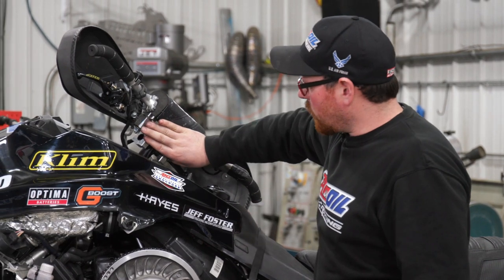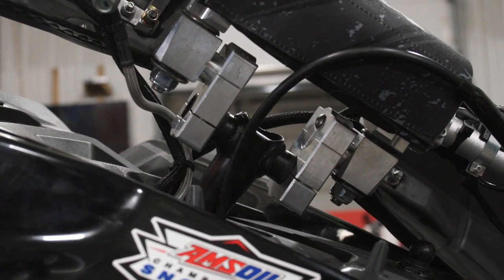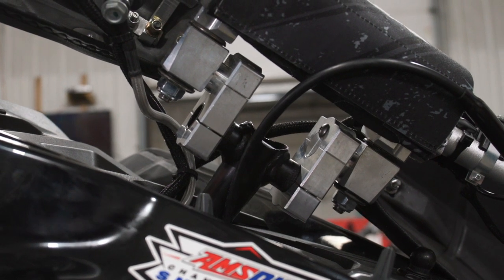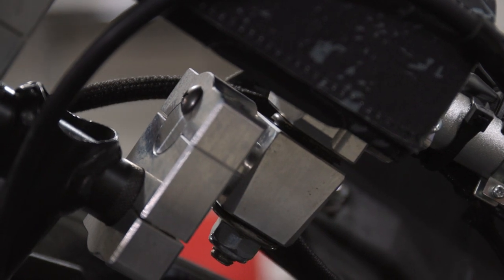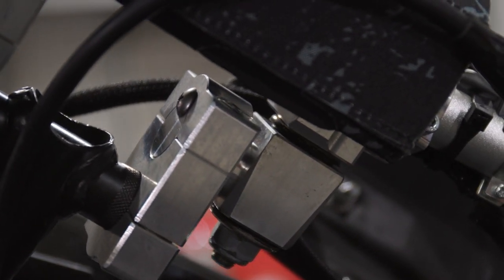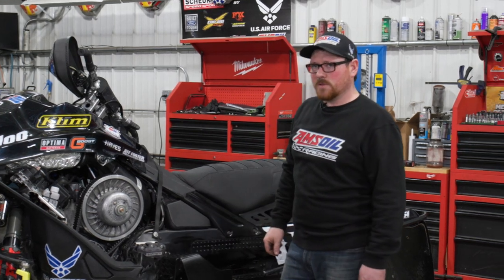In the middle is a very important piece — a vibration dampening clamp. If you were to run without it, you get a lot of vibrations coming through the handlebars that can make the drivers' arms go numb. This piece helps isolate and minimize vibration coming through the handlebars, helping their arms last a lot longer for the entire race.